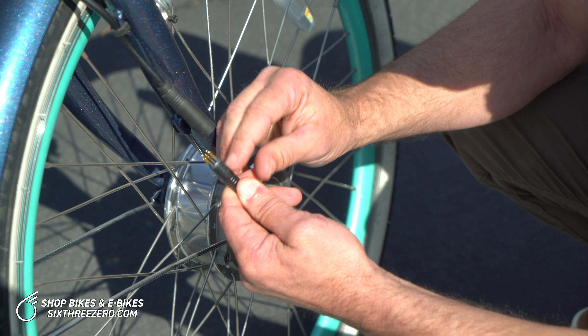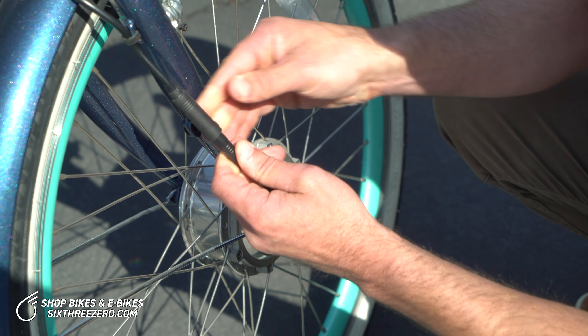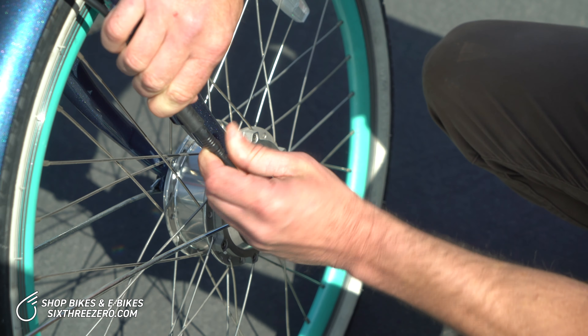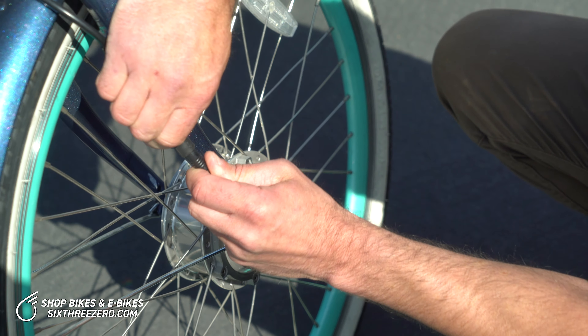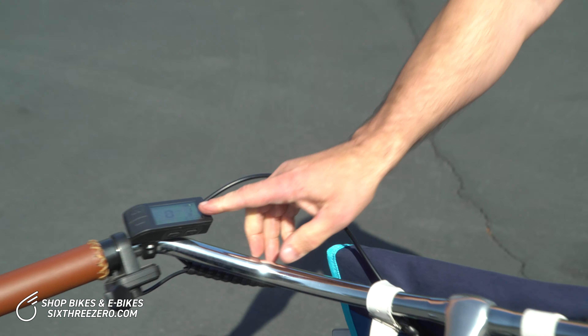You probably can't catch it on camera, but it's a tiny little line. You need to shove these together where the arrows line up, but you can't just do it part way — it has to go all the way to that line. So I've got to push it until that line is covered. I just did it. Now the check engine light should be gone. It is.